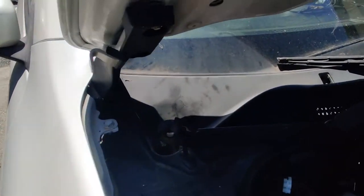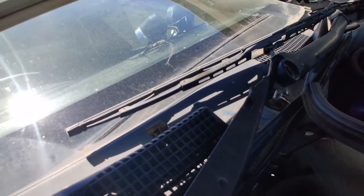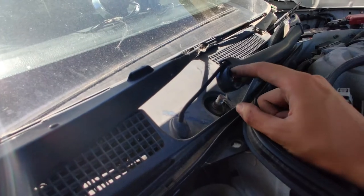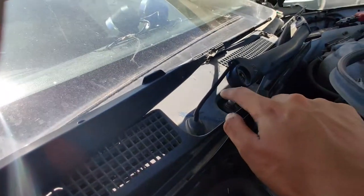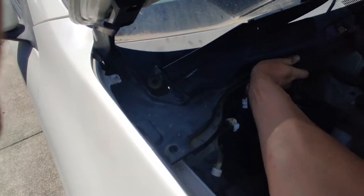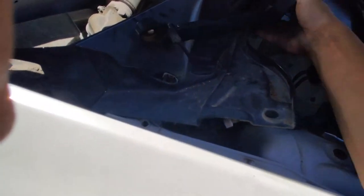After you've done all of that, here comes probably the hardest part: removing the wiper blade arms. If yours isn't old like mine, you'll probably have better luck getting them off. Mine is pretty seized up. After removing the 14mm bolts, put a flat head screwdriver — with something wrapped around it so you don't damage the cover — and while you're prying it, hammer the bolt through the hole in the arm. It'll come off. Then it's as simple as pulling the whole piece forward and removing the arms out of the way.